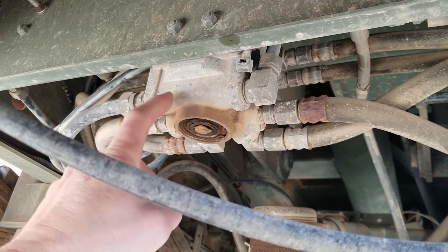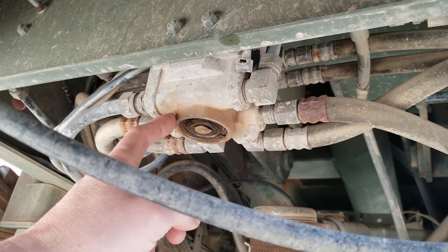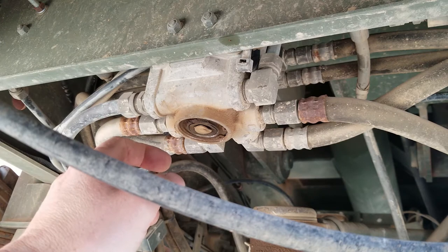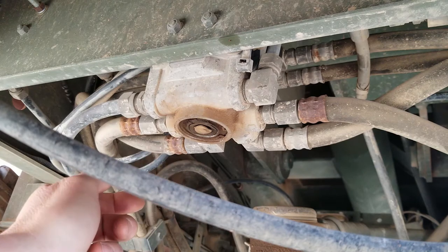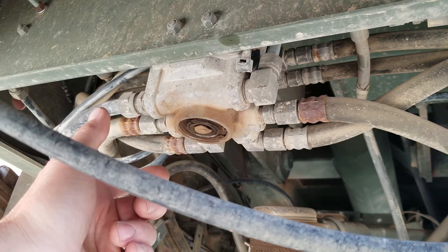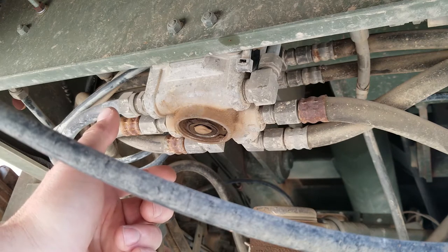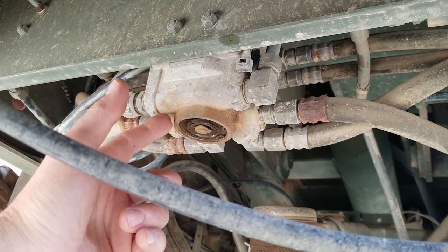In order to do that, it basically functions similarly to a regulator in that it takes proportionate air pressure and controls a piston or a diaphragm to allow air movement through this valve to the wheel cylinders, and any excess air from releasing the brakes ends up getting dumped out through this. But what ends up happening is when you're holding down the brakes at a partial depression, if you hold the brakes partway, it just continually bleeds off air. And so I think there's probably an O-ring or something like that that's failed in there.